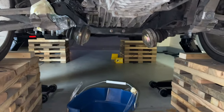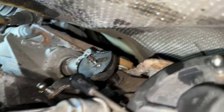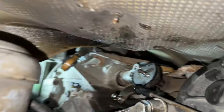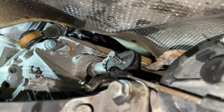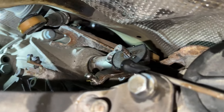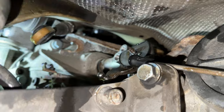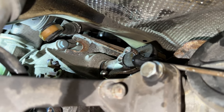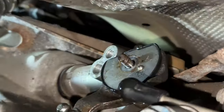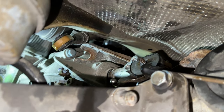So this is the current situation — I'm not going to sugarcoat it. These were all rusted, and having removed the bolt that bolted the slave cylinder in place turned out to be a massive mistake. The slave cylinder actually looks like it's a newer part. I soaked this all in brake fluid because the bolts were rusted on and terrible to remove. In the end, we decided you can bleed the system dry — once it's devoid of fluid, you can pull off the main line as well. But that was rusted on. Now that the slave cylinder is disconnected, I'm going to put the link mechanism rusty nut back on and proceed with the removal of the transmission.